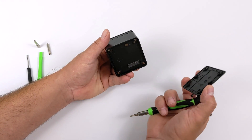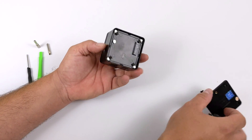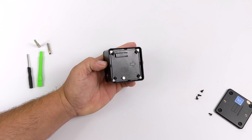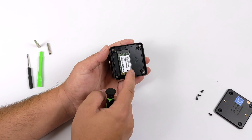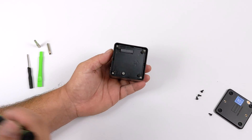We're going to go ahead and get these screws out. And once we have those out, we can pull the bottom right off. If we take a look inside of the Lark Box itself, we have that M.2 slot. This is going to allow me to add that 512 gigabyte SSD. It's a 2242 SSD, so it's one of the smaller ones and they do get quite expensive. But I'll save that for the reassembly because we need to get a little deeper in here.